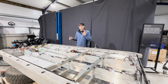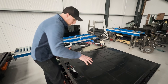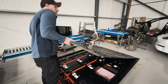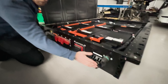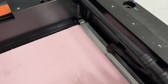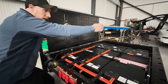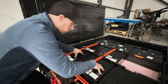We're now going to quickly jump to the other unit and show you inside one of the new packs. As you can see, the lid is completely different — it's actually stamped, so it's a lot more substantial, and it's in steel. The front of the pack is completely different with different mountings and a coolant in and out. The cooling system inside is a bit more like you see in a Tesla — there's an inlet point that drops down to each of the cooling plates, which run under each battery module. Instead of long plates they've gone sectional, with just a manifold that clips in all the way up, which is way better.